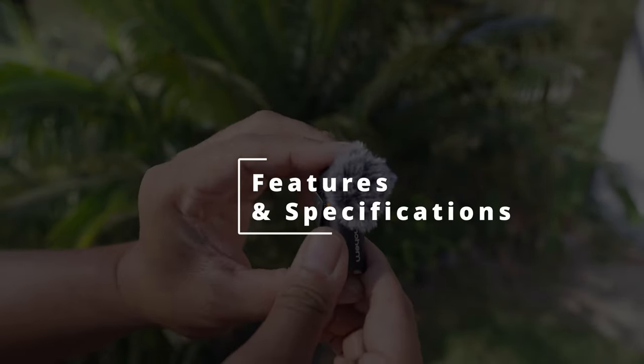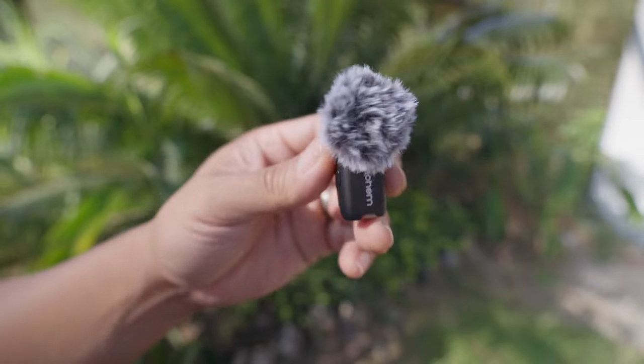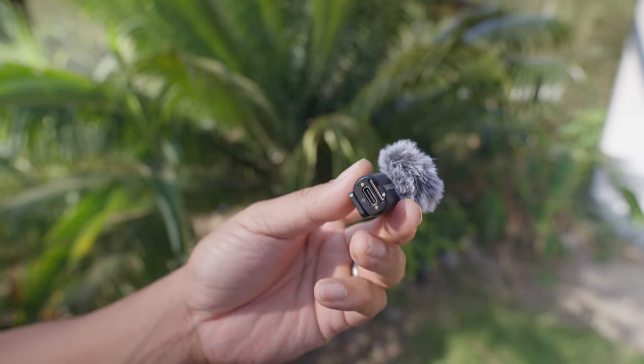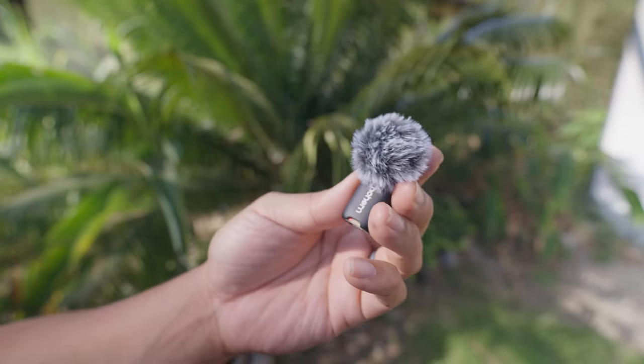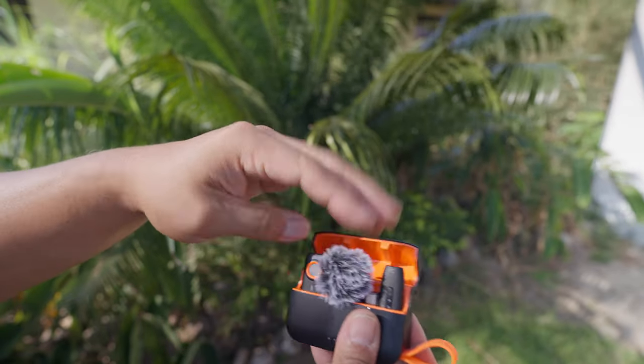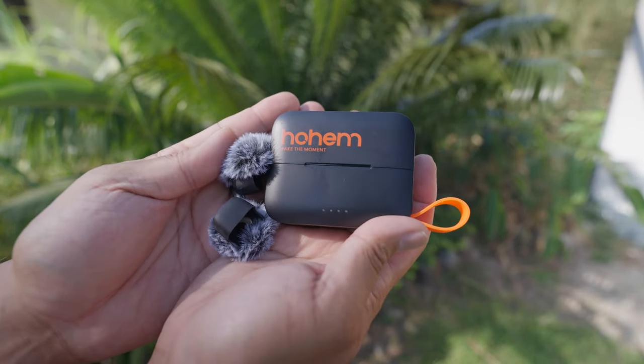It's got a forward-facing omni-directional microphone that can be either clip mounted or magnetically mounted. It has USB-C or lightning direct connection from the receiver so you can plug it into your smartphone or cameras with compatible USB-C outlets as well as computers, Windows or Mac. There are three levels of DSP-based noise cancellation — in reality it's only two levels because one level is no noise cancellation at all, giving you normal strength and strong noise cancellation.